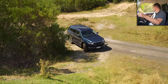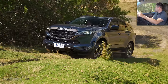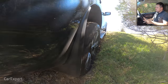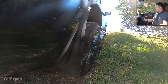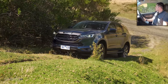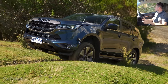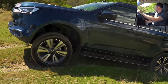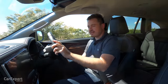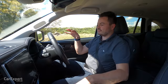Take two for the hill — this time I'll go up and come to a stop to see how it performs from stationary. I'll bring it up to around about there, come to a stop, and roll onto the throttle. Oh, it's struggling a little — rear diff locked and 4WD low range. It's not loving that at all — I think we're just digging a hole there. Try that once more — got there in the end, but a whole lot more of a struggle. It seems that when we came to a full stop, it didn't really love taking off again once the car was fully stationary.